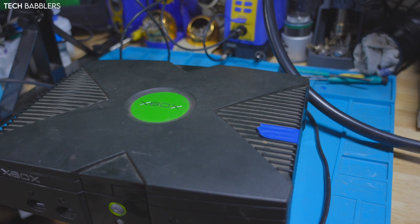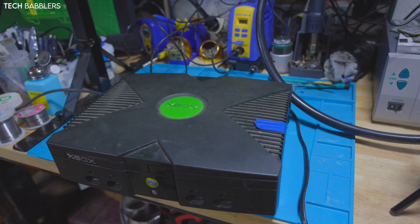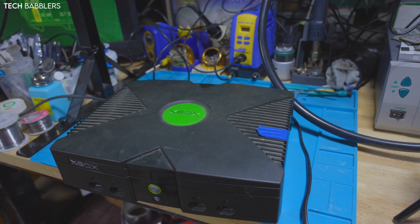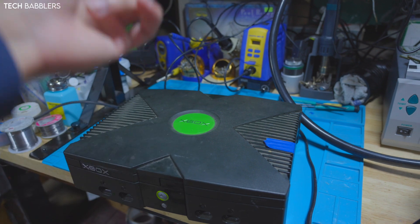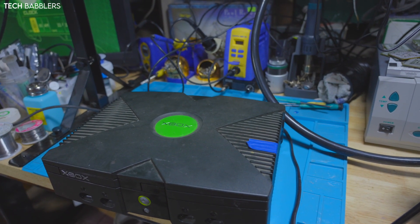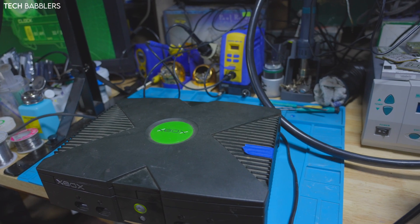For retail games, I believe you have to patch them or else they run funky. I think it might also be useful if you're using one of those make megahertz HDMI chips — it might help with the 720p output. Basically, what we're going to do in this video is open this up, put it on my reflow machine, remove the CPU, clean it, put on the interposer, put the chip on, and hopefully it all works. Pretty straightforward, so we're just gonna get to doing that.